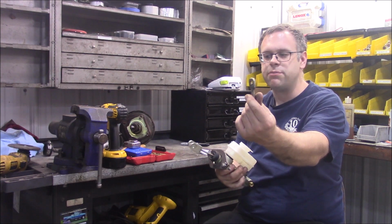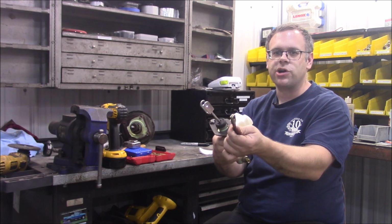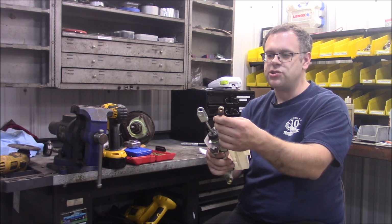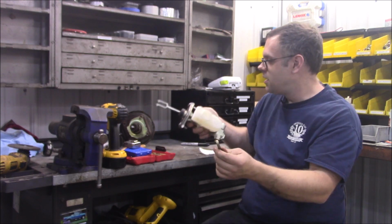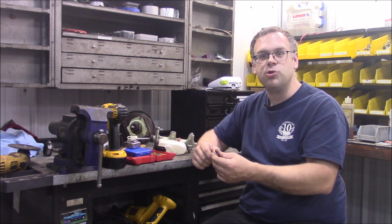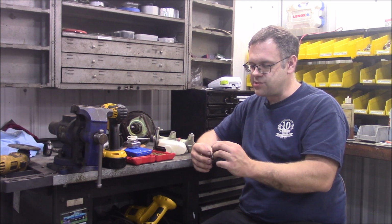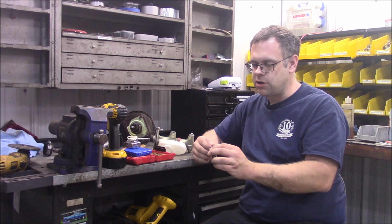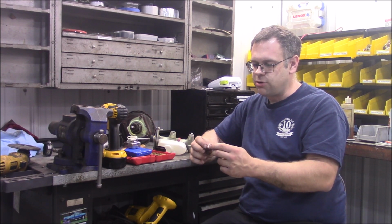Okay, so here's the situation with the brakes. Here's the one off the Yugo power brake booster, and here's this one. It's like a hole, but it might not really go in the pedal that good. So what I'm going to do is cut that flange off of there and weld the Yugo one onto there. Now I was going to be super fancy, and I was trying to drill this out and then slide it over that tube and put a hole in it and weld it again so it wouldn't come off. But right at the last second, the drill bit broke off in it. And now I just have a hardened drill bit in there that's eating up every other drill bit I try. So that's what I get for trying to do it right. So now I'm just going to hack it.